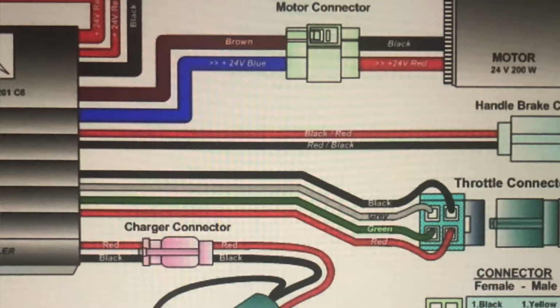That green wire takes a signal of 0 to 4.4 volts. But the red wire has 4.4 volts on it all the time, the black is a ground, and the grey takes a 24 volt connection. So thinking about this,